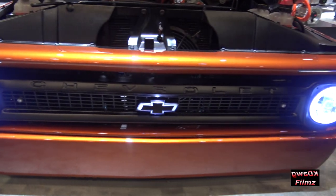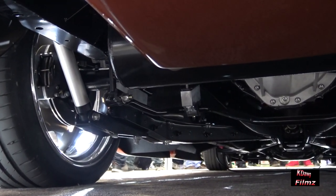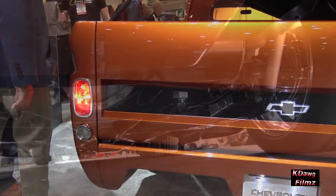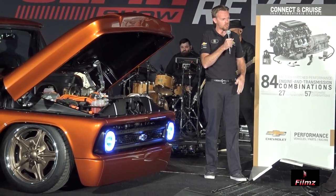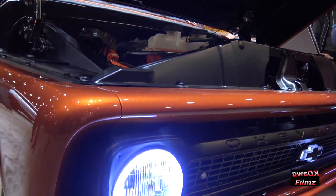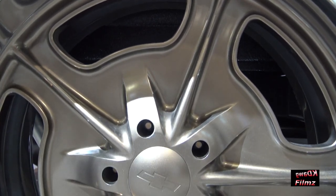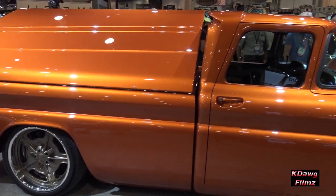It features a lot of carbon composite components, including our front roll pan, rear roll pan, and tonneau cover, developed by our design studio for aero performance. Body mods include a recessed grille, smooth hood, shaped drip rails, extended rockers, raised rear wheel openings, and a smooth tailgate. LED lighting is throughout the entire vehicle, including our signature LED lighted bow ties on the front, rear, and on the dash. The chassis has been reinforced dramatically with heavy-duty adjustable air suspension, 12-inch disc brakes, 20-inch front and 22-inch rear wheels. We've also developed a cooling system to allow the fast charge time, as well as regenerative braking.